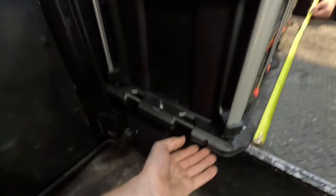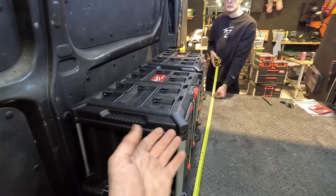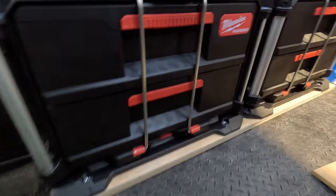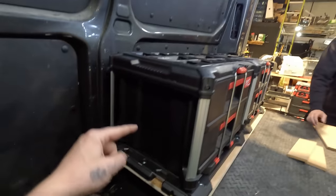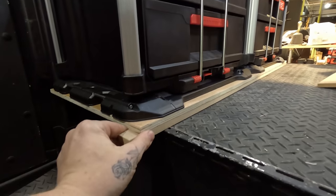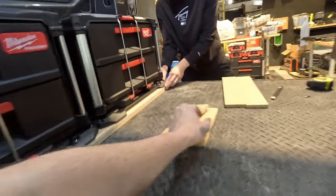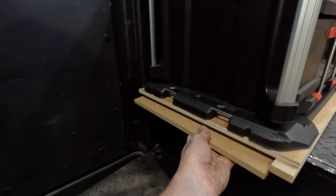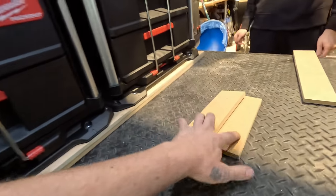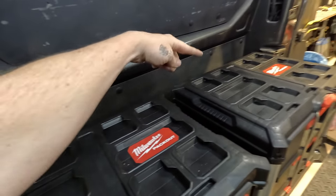We've removed this racking here — this is the overhang we've got. We're going to cut a piece of ply to level it up, push it back, screw it. We've cut some 12mm ply coming across, because we have the bulge of the wheel arch coming up. We've had to bring it up — this should be 12mm as well. We've created some edges so that's going to sit in here, that'll lift that up, and then two packers just to pack it up behind this bit because the wheel arch is only so big.